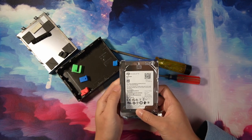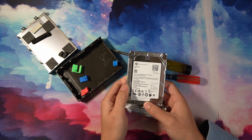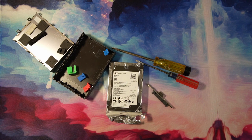And here is your SATA port. If you look at the drive, it says Barracuda 5TB — so that's exactly the drive you would buy if you went to a store and purchased the SATA drive directly. That's all you need to do to get your internal hard drive. One thing I want to stress: shucking a hard drive will void its warranty. So I strongly recommend you thoroughly test your USB hard drive before shucking it — connect it to your computer via USB, do some file transfers, and do a health check of the drive before you shuck it.